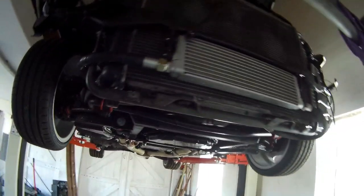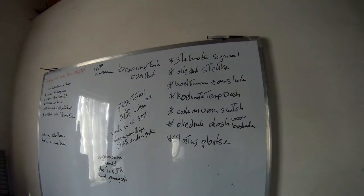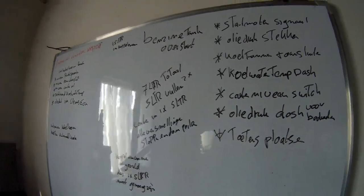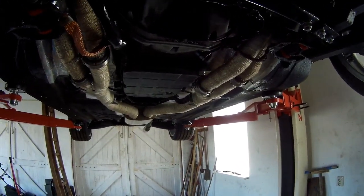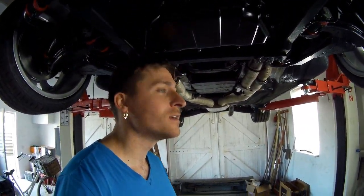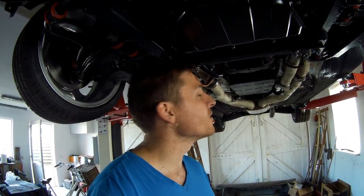So for the rest, everything is connected. The next thing I'm going to do now is, it's all in Dutch here, but the Dutch people can read this. So what do I do with the transmission? The transmission has 5 liters of oil in the sump. That's how the book tells you to do it. Just put 5 liters in it. Normally you will have to start the engine, and then go through all the gears. Then stop the engine and have a look at what the oil level is doing. If it has dropped so much that you don't have any oil on the dipstick, then you have to pour something in. And then you have to get it up to 80 degrees and fill it up to top level.